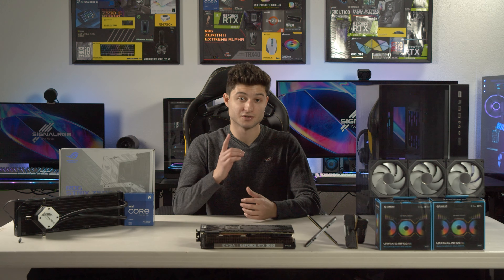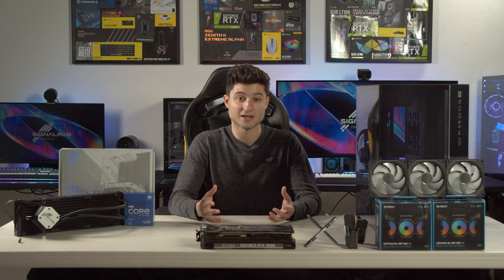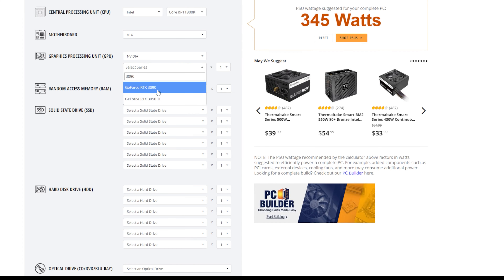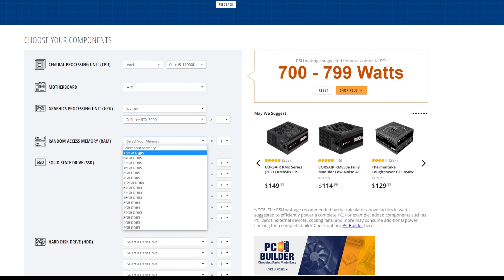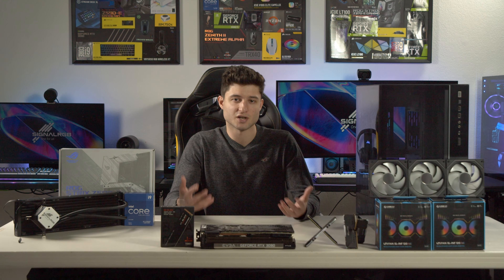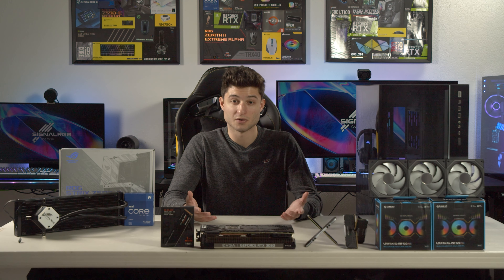On the topic of things fitting — storage. You'll want an SSD with plenty of space for your games, since some titles like Call of Duty Warzone 2 are literally over 100GB. I don't get anything less than 1TB these days, especially since prices have dropped a lot. I'm going with the 1TB WD Black SN850X — for only $100 you get Gen 4 PCIe speeds up to 7300MB/s. Moving on to the power supply: use a power supply calculator to determine how much power you need. I'm going with the 1000W EVGA Supernova, which is more than enough. There are RGB PSU options, but they wouldn't make sense with my case since you can't see them.